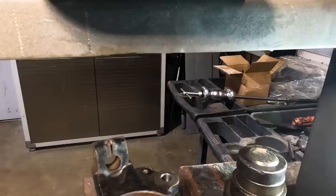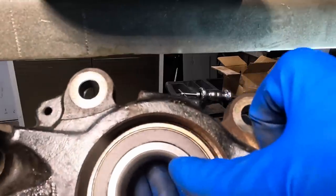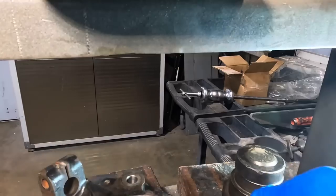Looky there — I am right. I see it. It says right here, ABS sensor side. Right there — very fine print, ABS sensor side. It's laser engraved. Okay, so we have a snap ring that has to go into this, because we need something to retain this bearing when we go to press in the hub from the other side.